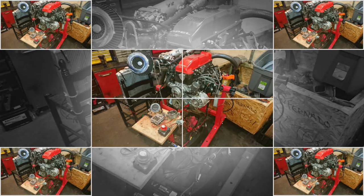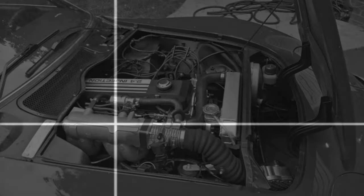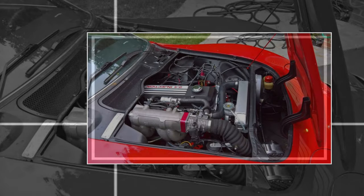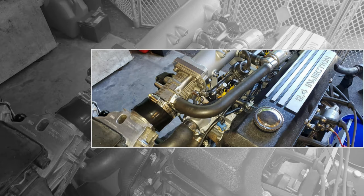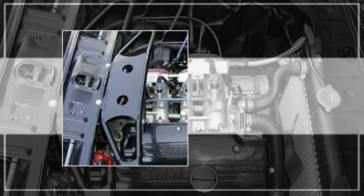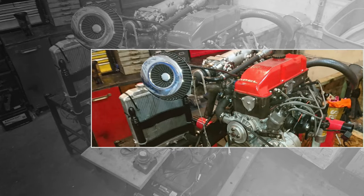Similar to the Motronic from the Opel I showed earlier. If you have a vehicle that originally came with a carburetor or early L-Jetronic systems — the 75s got very early Jetronic and it continued through the 90s — this applies to your M10 motors, M30 motors, your Volvos, your Land Rovers. If a car out there came with fuel injection, you can use that. All MPI multi-port injection uses the same connectors for the injectors, so as long as your throttle position switch matches your computer and your injectors match your motor, you have the basic components you need.